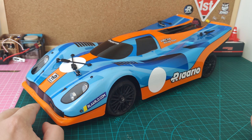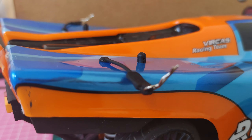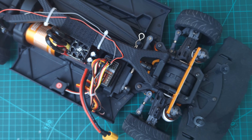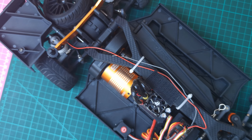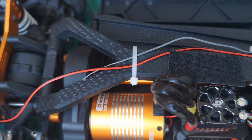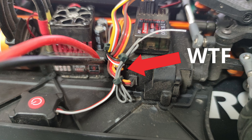Let's get the body off and have a look inside. You've got a big beefy chassis brace across the top — it's plastic on this version but carbon on the carbon fiber version. Here's a little tip: make sure your antenna is running along the center brace, because mine came all bundled up and the range was terrible. I was told this had been fixed, but mine still came like this.